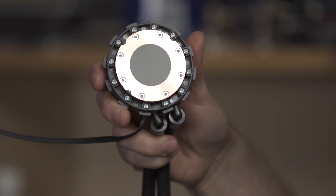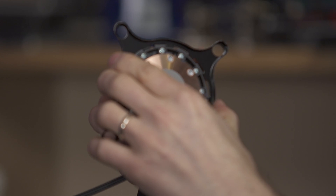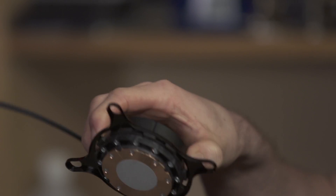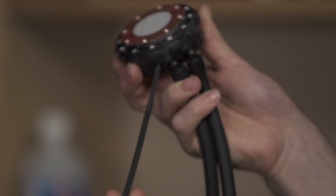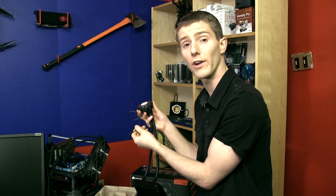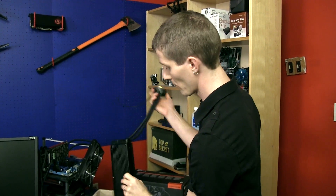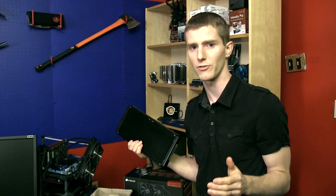The design for mounting is the traditional ring mounting bracket we've seen many times before, with a copper base that has high-quality thermal compound pre-applied. The pump is powered by a black ribbon cable with a three-pin connector, so it'll plug into either a PWM CPU fan connector or a legacy three-pin connector. You can use DC control to lower the pump speed, but I really wouldn't recommend doing that — in 100 cases out of 100, just don't do that.